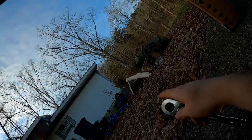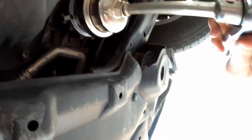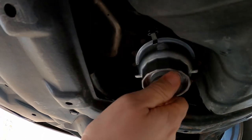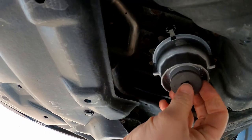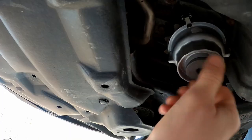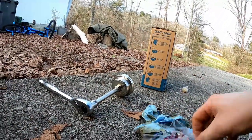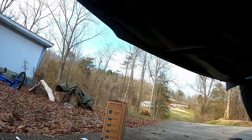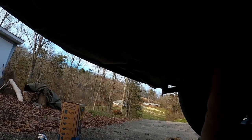Now we are going to get our filter wrench, and our half-inch drive extension. This fits on the new housing just as well as the old one — going to make this thing nice and snug. With the cap mounted on the car, it is much easier to undo this plug. Just want to pull it off to make sure it does indeed have an O-ring in there — and it does. So this replacement came with O-rings, so I'm not using the ones that came with the filter. I am going to save them just in case.